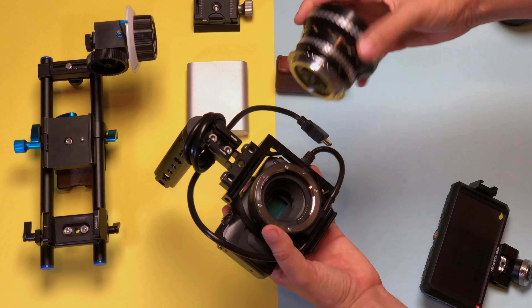First of all, we're going to fix the battery issue, because the battery in this camera is very small. We have these little batteries called LP-E12, which don't provide too much juice — around 45 minutes to one hour of recording time. For that, we're going to use a DC coupler connected to a power bank to solve the battery issue.